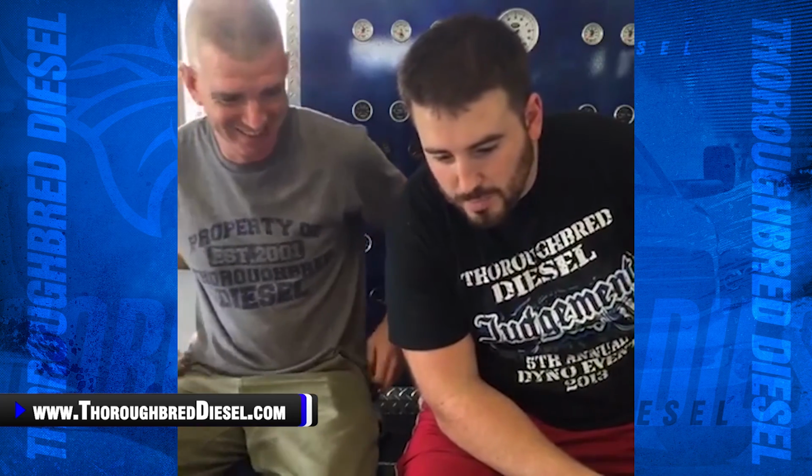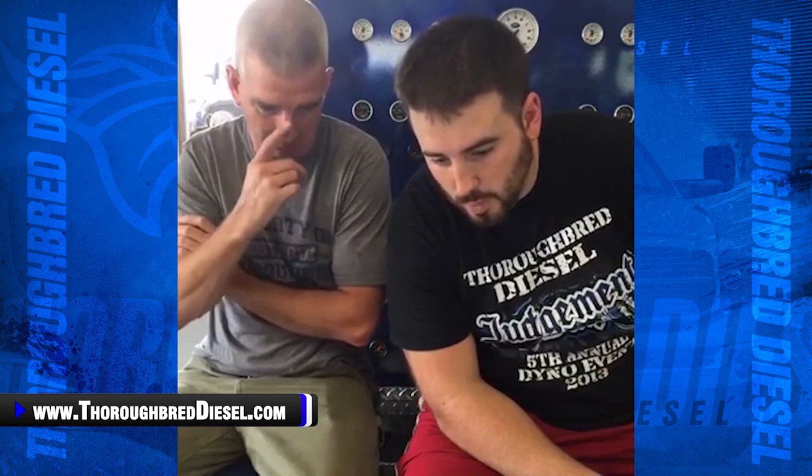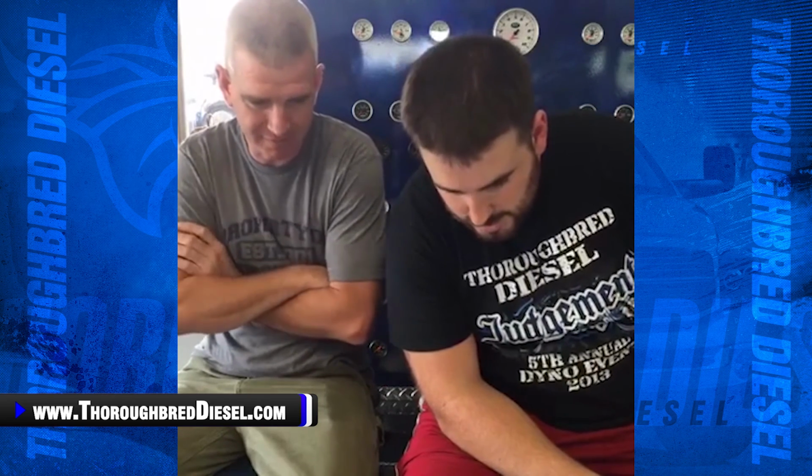Did a turbo swap on a 2011 6.7 Power Stroke. Aurora 4000 hits 18 psi, then falls on its face. Just uploaded new custom tunes for non-VGT and still doesn't work. Oof.